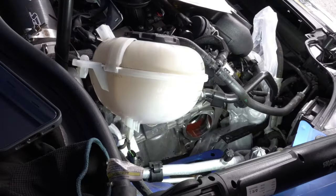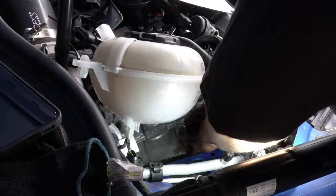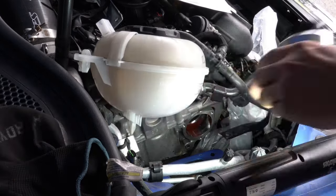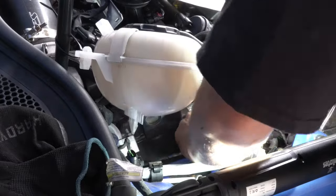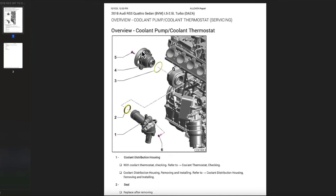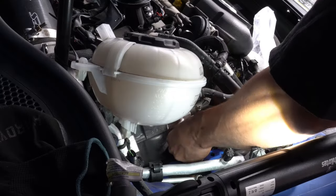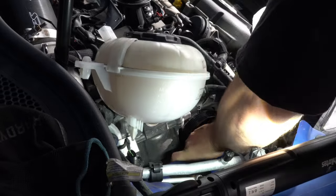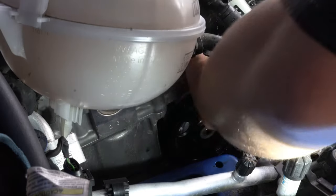Finally we're at the halfway point and can start putting everything back together. Make sure to clean and wipe off the mating surface of the engine — that's where the water pump inner gasket will seal. If you don't clean it you risk it leaking again. Tighten the three water pump bolts to 9 Newton meters or 6.5 foot-pounds. Then install the rubber hose back on and have a partner help put the serpentine belt back on.